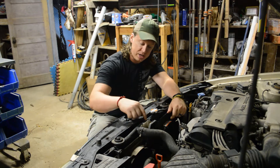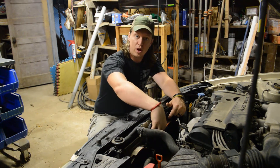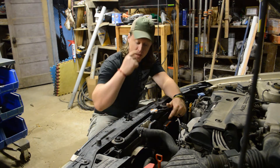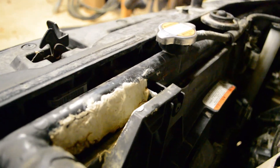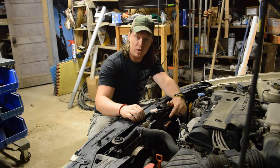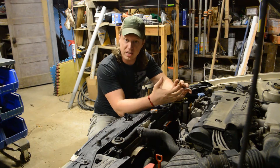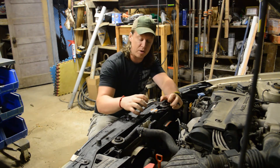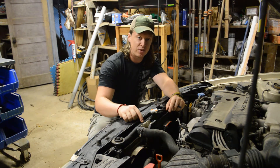Where this radiator actually failed was here on the top. This radiator is both metal and plastic — it's got metal tubes and fins but plastic caps. This piece on top is all plastic and where it cracked was right here. We tried JB water weld, and that held for a while, but the plastic wasn't abrasive enough to hold it. We tried sanding and routing it out but couldn't get a high-pressure seal. These radiators are pressurized, so whatever you use to fix the plastic has to hold up to that pressure.